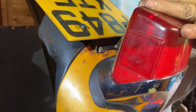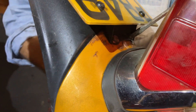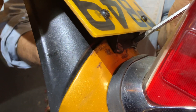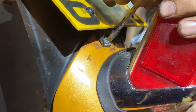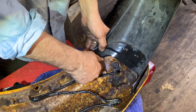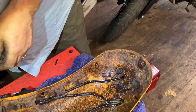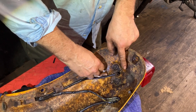Let's do the other one — really little 8mm, they'll snap really easy one would imagine. Look at that, we've been lucky today, makes a change. So I'm going to take that all the way out. It just comes off like that — that's the number plate. I'll just take the number plate bracket off, take the mud flap off now. Put the nuts back on. And then it's just the rear light — there's a ratchet, that's 10mm.